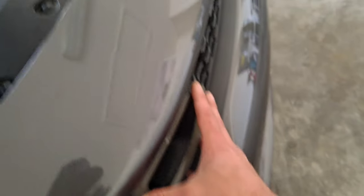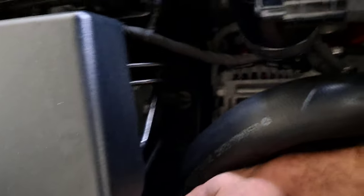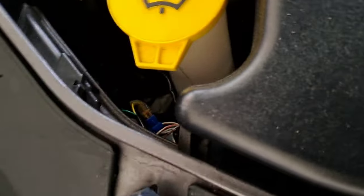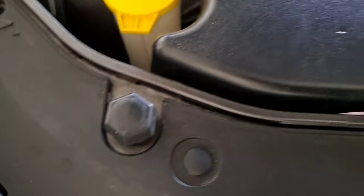You put the light in there first and feed the wires. There's a hole up in here — you can feed the wires using a coat hanger or your hand like I did. It's real tight, but you can get up in there, grab the wires, and feed them through. See my hand? There's a hole deep up in here. And you ain't even got to drop the bumper, man.